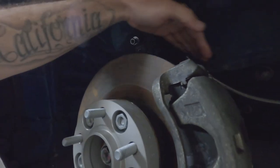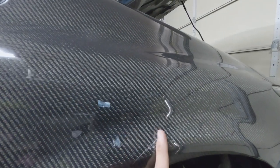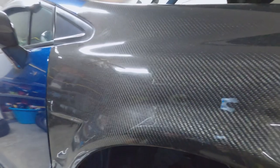But at the moment, with these issues I'm running into, doing the strut bracket is number one, a must. Then doing the LCA extension to counterbalance the effects of the strut bracket and straighten it out, so that this bottom part isn't smacking the fender well, and centering out my camber plate so that the bag sits right in the middle and has plenty of clearance when it airs out. And I still have to adjust my height. You can kind of see, right here when I did my fender video, and I haven't shown this unless people follow me on Instagram, I aired out and just said, forget it, YOLO, let's just try it and see what happens.